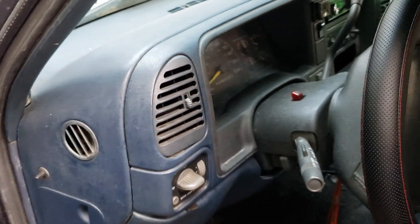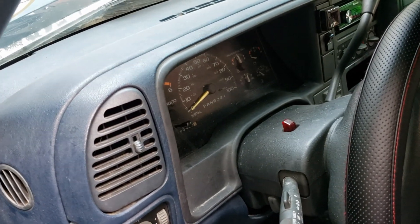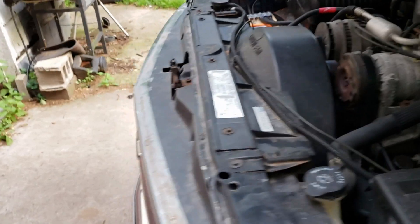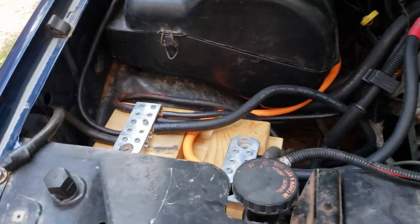That's why you wouldn't want to have a battery up front — you have plenty to start your vehicle from the back. Why abuse your batteries and have them in the heat? It's not just the reduced life, but also the reduced performance of having your battery right next to your engine and your hot alternator.